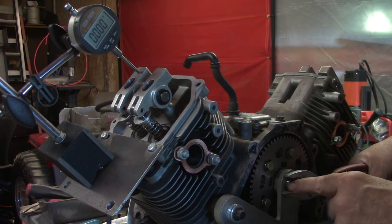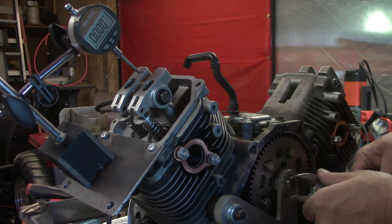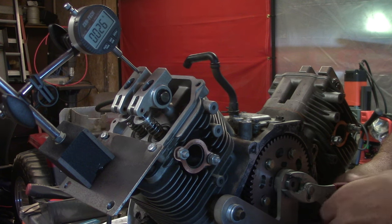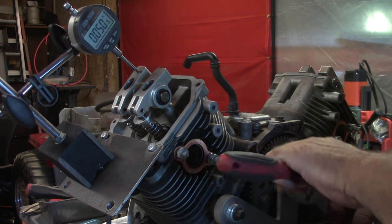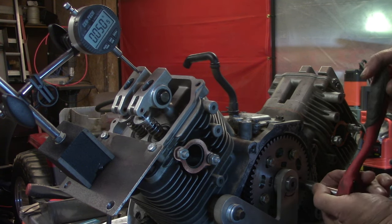I've got this all set in place with the four bolts just loose. We are set at zero. I take a pair of pliers — you're not going to hurt it because you're not putting that much pressure on it — and I get my ratchet handy. Then I rotate the cam clockwise, because that's the way it rotates when the motor runs. Looking at the dial indicator, we want to bring that up to the 50 thousandths mark. There's 50 thousandths — now I'll rotate and lock those bolts in.